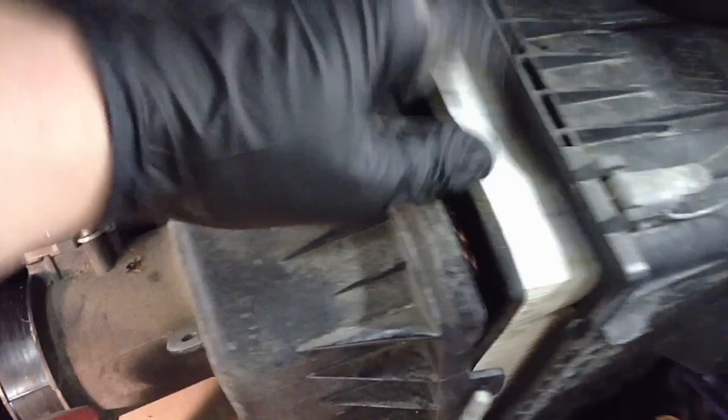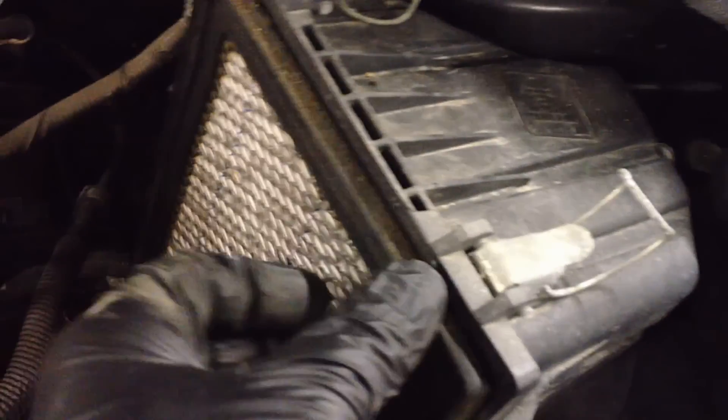We're going to take it off real quick. This is another important step because you want to check the air filter — not just to see if it's clean or not. You want to make sure it's sitting all the way around, flat against there, and there's no tears in this foam neoprene type seal or in the pleats here.